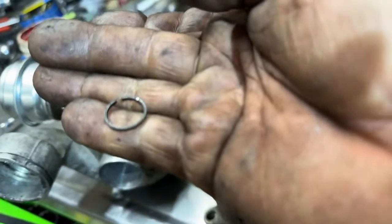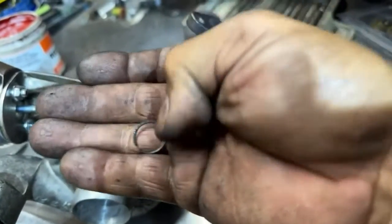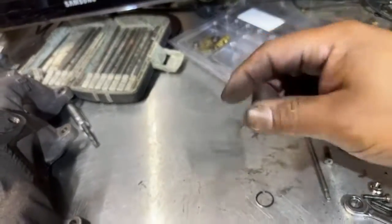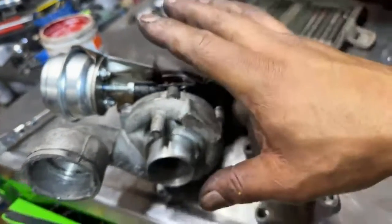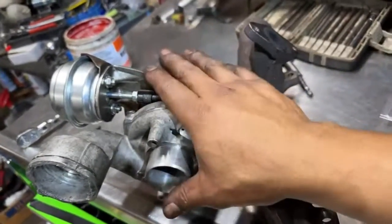The other side has two gaps in there, two steps. And that's why it was leaking oil. Probably the pressure forced it and ground it, or maybe these two. Who knows? That one over here was bad too. So now with everything in there good and new, we're going to see if this one doesn't smoke anymore.